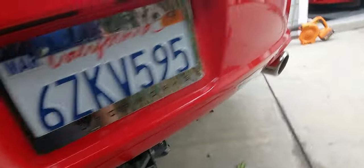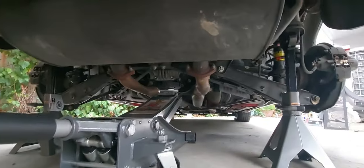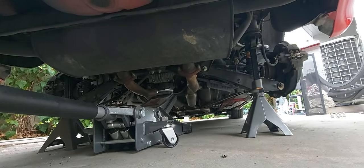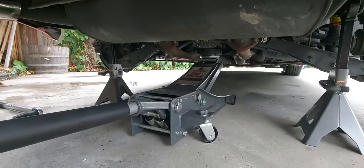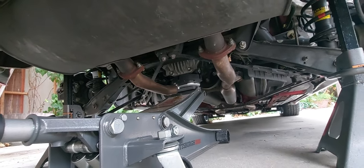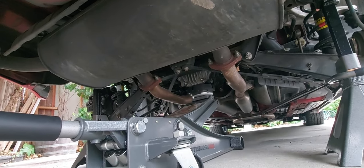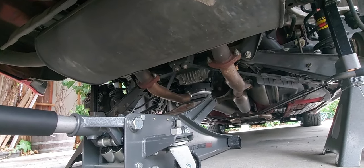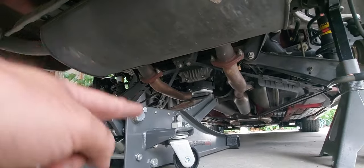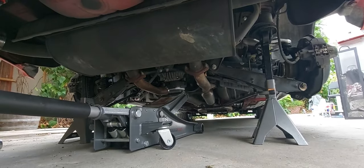Going back under — jacked up properly. As you can see, one jack stand is right there and one on the other side as I showed you earlier. The trick to lift the car up the first time is that differential plate. The entire car is sitting on the jack stands, but I'm also leaving the hydraulic jack in place just to be on the safe side — the car is only about 30–40% on the hydraulic jack, the rest is sitting on the stands.